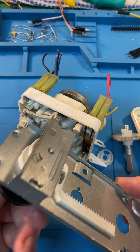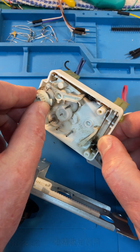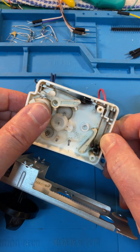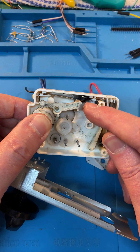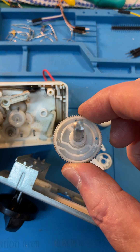So this device over here, which is your power selector knob, works as a rack which engages on this over here, which is a cam system. That varies the duty cycle through its motor, closing that set of contacts to vary the power level.